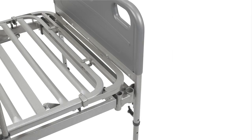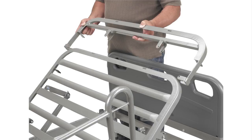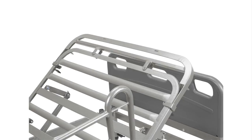To install the 15660 EXTKIT, remove the headboard and attach head portion of 15660 EXTKIT to head section hooks of bed by sliding on and securing the head extension, shorter piece, and reattach the headboard. Raise the head spring. Slide the head spring extension component onto head section of the bed deck and secure using enclosed hardware.